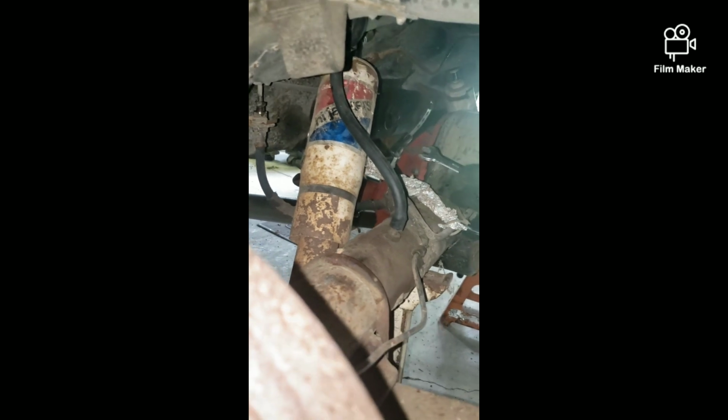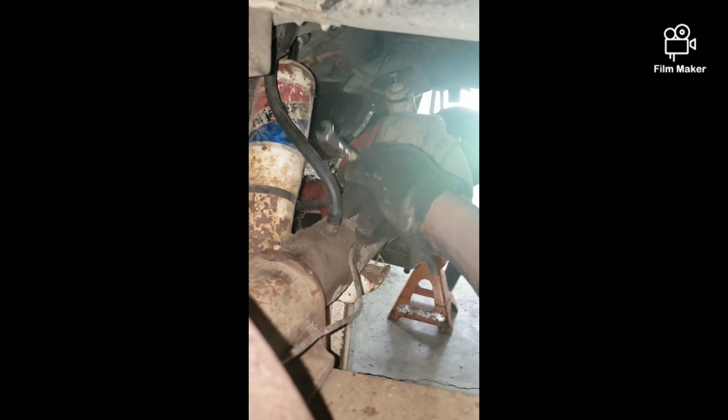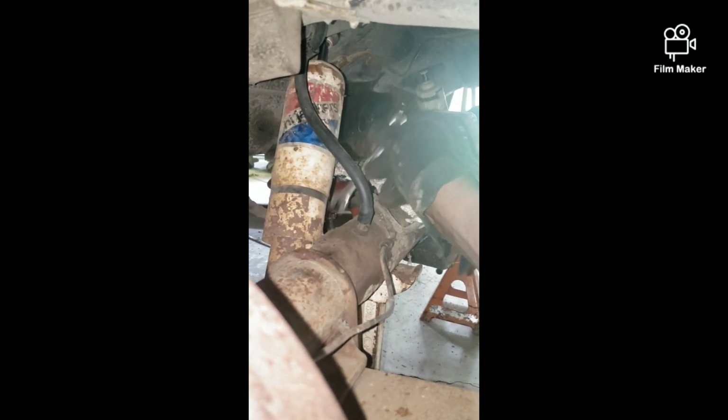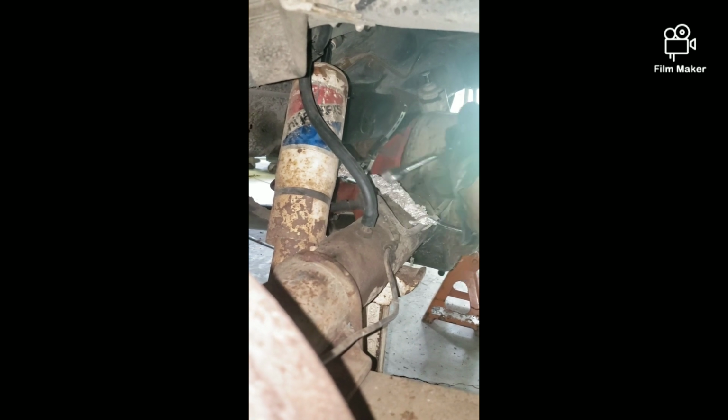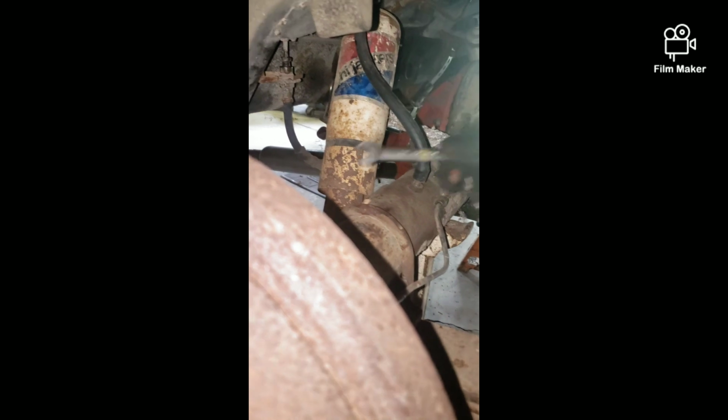But get this stuff taken off, and then I'll go to the other side, check for all wires and hoses on that side. And after that, work on getting the hijackers disconnected, which there's a nut at the bottom to unscrew. And then after that, I will go ahead and switch these jack stands and put those on the actual frame instead of on the axle. And I'll get these leaf springs out the way, and this thing should come on down.